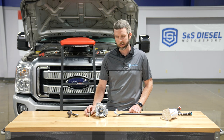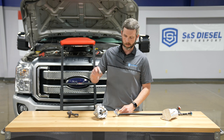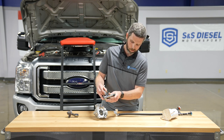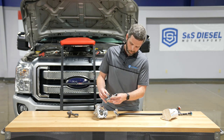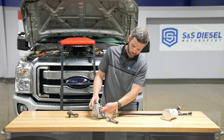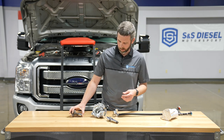The reason we're not worried about doing the absolute worst thing to this truck is because this is what the CP4 pump looks like. A two-lobe cam sits down in there, and this is the roller that rides on it. We've intentionally damaged it, and it's going to sit in there turned 90 degrees — no chance of survival — digging a groove right through, making metal shrapnel, doing its best to wreck the whole rest of the system. In a normal failure, fuel comes from the filter into the bottom end of the pump, up through a passage to the metering unit, through to the high-pressure heads, and then to your injectors. That's a $10,000–$12,000 repair bill when this fails.